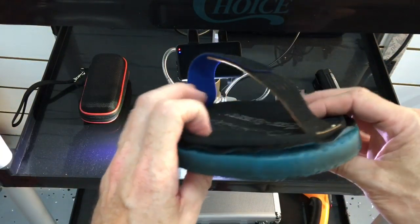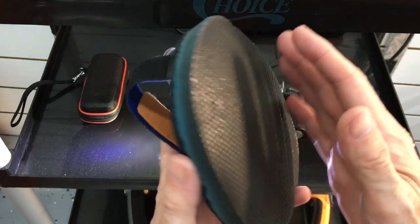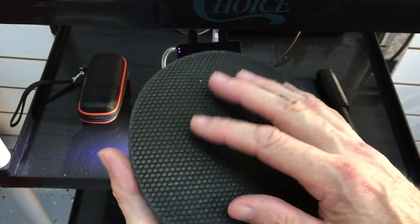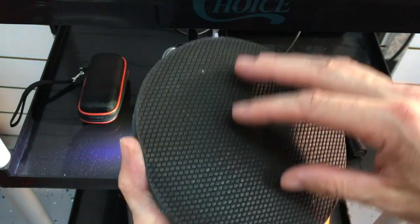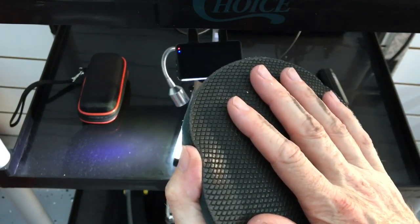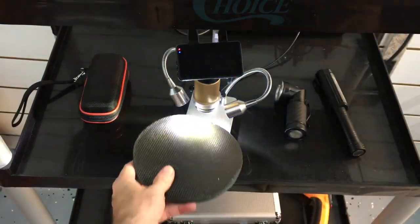The very last thing I want to show you is this very old Auto Scrub System pad from NanoSkin. It cost about $50, but I got my money's worth — I used it for quite a few cars. What I want to show you is what it looks like after all that use. When they get old, you're going to notice the texture gets harder and stiffer — it's time to throw it away and grab a new one. It will not pick up dirt anymore and it's going to mar your paint. Under the microscope, you're going to see dry rotting taking place, holes that have been carved in, and cracks all the way across the surface. This will not only fail to pick up dirt and release it, but when you introduce it back to the car, you're going to be doing some heavy damage and marring. The material just breaks down naturally.